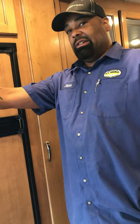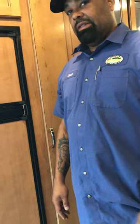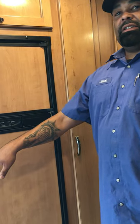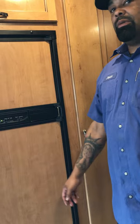They'll never get cold. So, in other words, I can go over to the place where it's stored, just throw that switch to gas, walk out. You don't even throw the gas, just throw it on auto. Because auto is going to see that it's not getting 120 power and then automatically switch over. So even with not turning anything else on, just go to auto. Correct. You will need your battery disconnect turned on, because it's pulling 12 volt to the board.